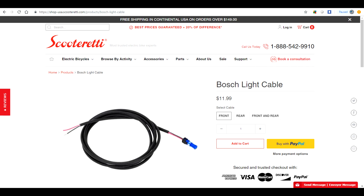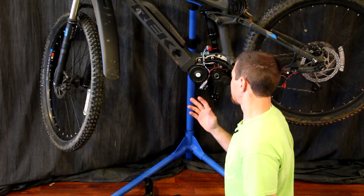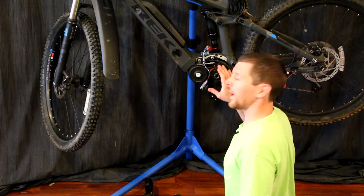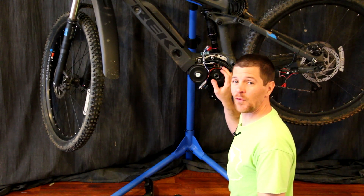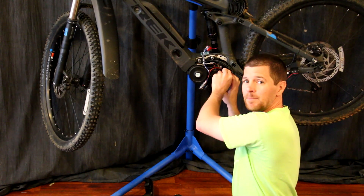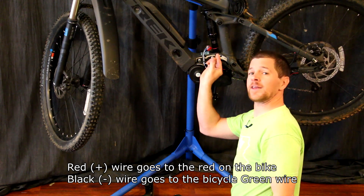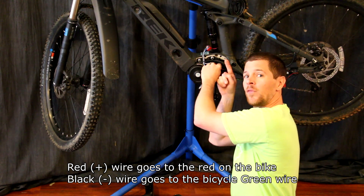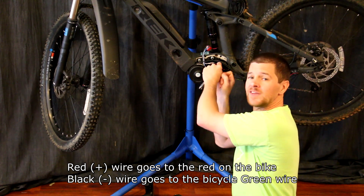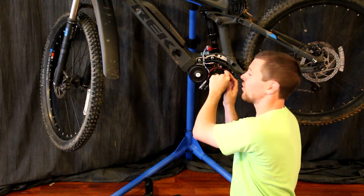There's a small tab on the side to keep it from going into the drive system and I just cut it off with a pair of diagonals. The way I'm getting power is from the bike's power system — that is the 36 volt lines. The way I tap them is I pulled the plug out, then I used a pair of wire strippers to open the insulation up. I then took these wires, wrapped them around that wire, soldered them in place, then put two layers of liquid electrical tape around them so that they don't short out.